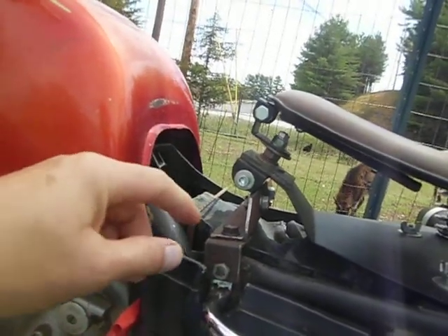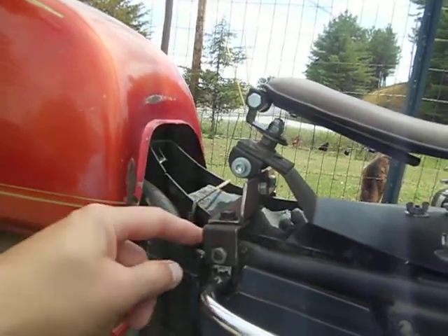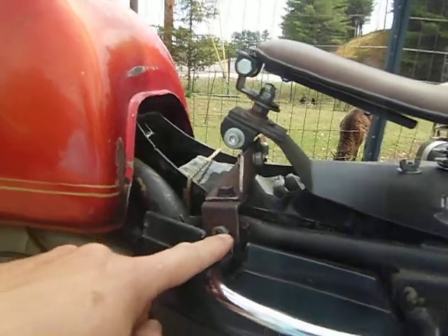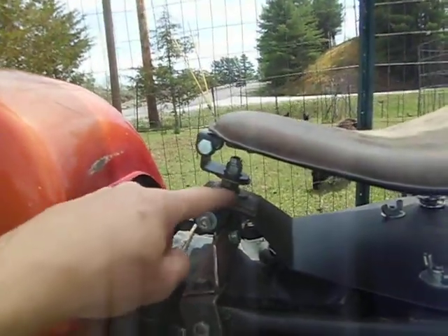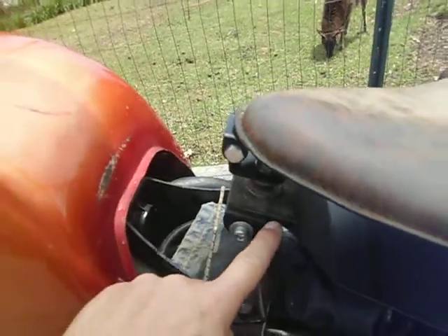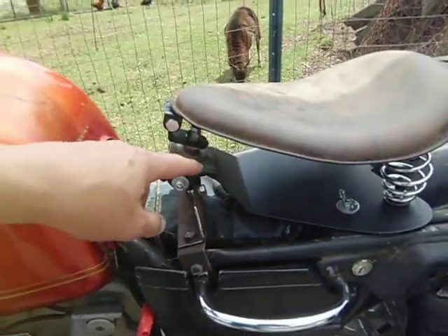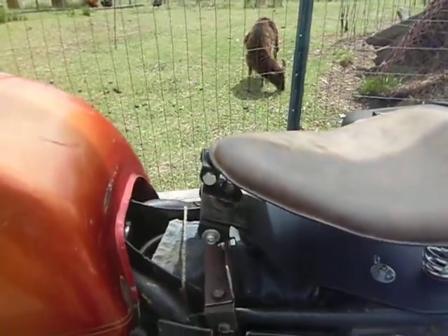It's probably better not to weld it because you have to do a little adjusting and fine-tuning to make it fit right. The frame bolts are already there, so this mounts right in there perfectly. You need reinforcement for the thin neck on this base plate right here because the custom mount tends to bend there, so that's always a good idea.